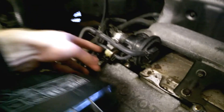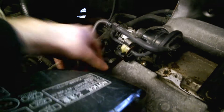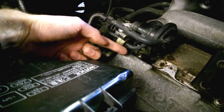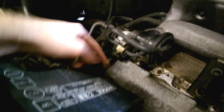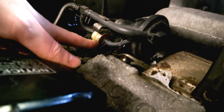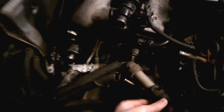I'm running the stock blow-off valve, but I've had a problem with this VTV valve - it's a vacuum delay valve apparently. It allows pressure to go one way but it's a check valve with a hole in it, so the pressure change is much slower in the other direction. These are about 50 quid, so I'm trying to find one from another car. They come in different ratings for the time delay. I haven't disconnected the coolant hoses yet from the top here, so they need to come off. Some air pipes have already been taken off.